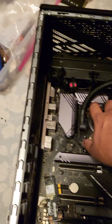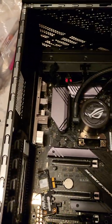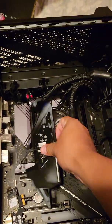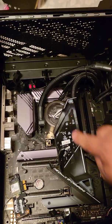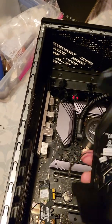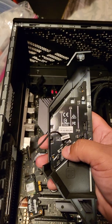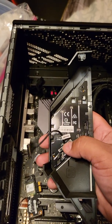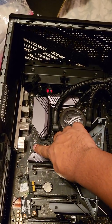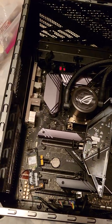You loosen up those screws, shift it to the right, and lean it up all the way until you get to the back side. There's a screw here and a screw here on the back that you remove to get the IO cover off — you have to do it from the back. Then I disconnected and reseated the LED connector. I'm about to reseat it now, hoping this thing comes back on.